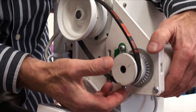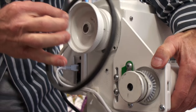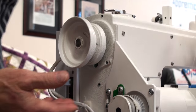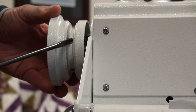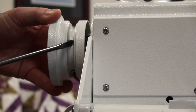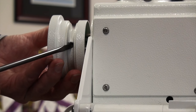We will lift the motor up so that we can get the belt off of the motor pulley, take the belt off of the hand wheel, and lower the motor down. With the belt removed, inside where the belt was we have two set screws. As we're turning the hand wheel counterclockwise, we have our first screw set on a spot on the shaft, and the second screw is not.